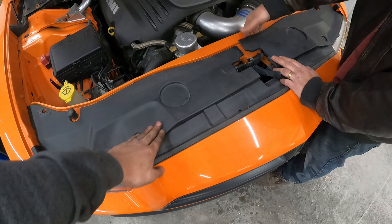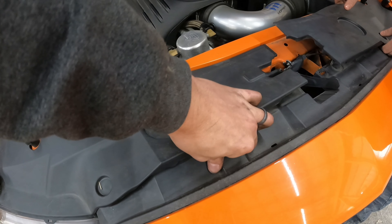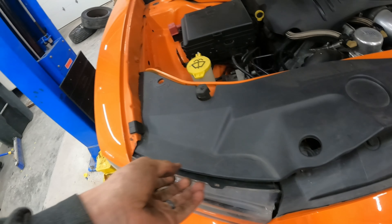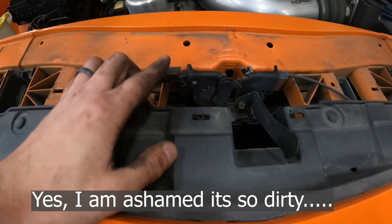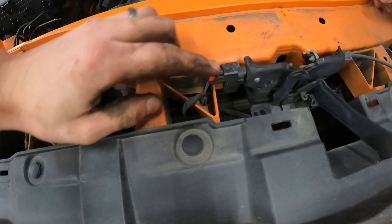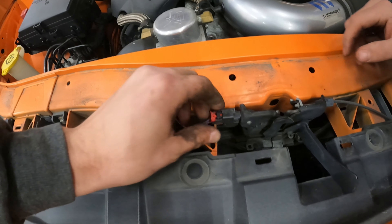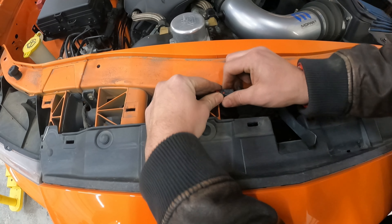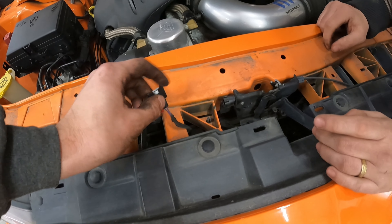First thing we have to do is remove this top piece. They're really just holding little plastic parts that should just pop out — you just got to give it a little bit of pulling and it should pop up. There are no bolts, nothing to it — it should just pop up and slide out. That's going to expose the latch a little more, and now we can see that electrical connector. For this, we're going to pull this red tab out — there we go. See that little red tab gets pulled out, and then we can pull this connector off. Sometimes they're a little stuck in there after being on there for years, but if you wiggle it back and forth and press down as you do it — there she comes. So that is our plug disconnected.